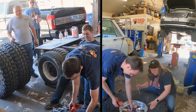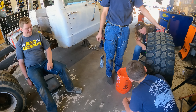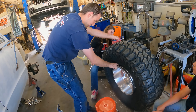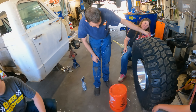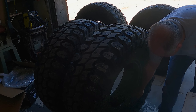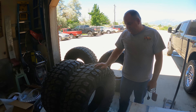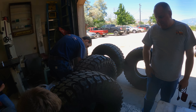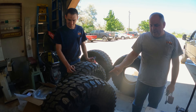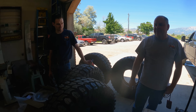We broke the bucket. The bead of the tire is so thick. This lip right here - see, it's on such a taper, it actually curves in if you feel it. We need to take a grinder and grind that back so it's more of a radius. It's already half gone on that one as we've gone around it. If you take a grinder and go around it and roll that back, it won't put so much pressure on and it'll slide over the sharp edge of the wheel too.